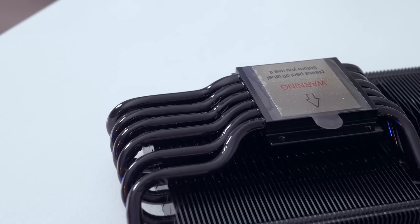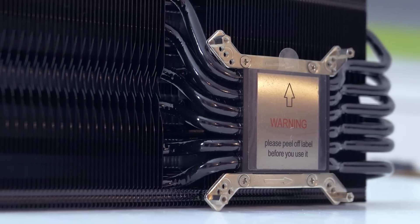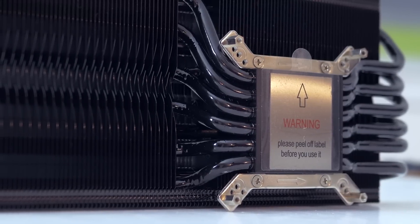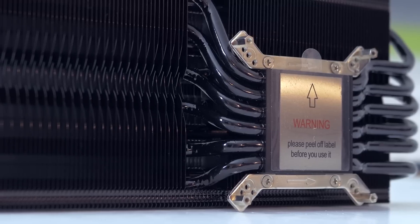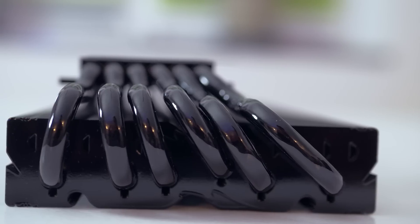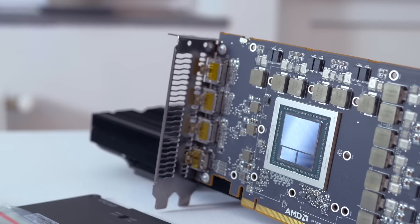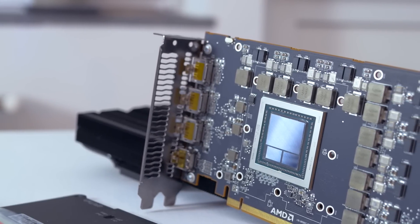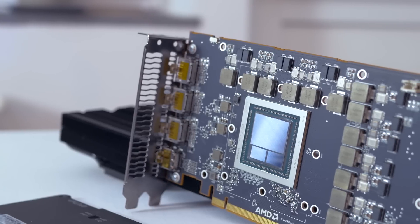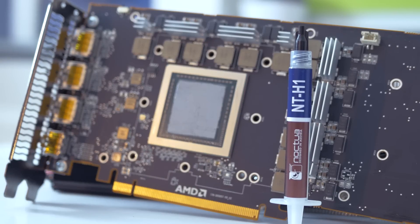Next, prepare the Morpheus for install. There are two brackets fixed with screws to the cooler body, and on these brackets you have hexagonal screws that go into the farthest holes. For the Vega retrofit, I've used the Mylar spacers provided in the kit for Hawaii GPUs. For GPU dies, the 'less is more' rule regarding thermal material is not applicable — there's no IHS here, so don't skimp on the thermal material. Spreading it works best for GPUs, especially large dies like this. I use Noctua NT-H1 since it's a great performing paste.